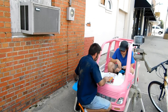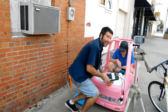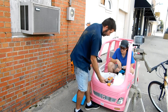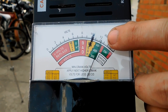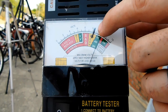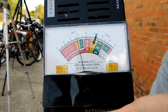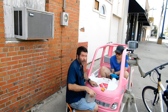So what we're gonna do is check the battery. We're gonna pop this blue hood, unplug it, and test it. I got one of these motorcycle load testers — what this does is it checks the amperage on the battery. We're going to plug this in. As you can see, it's got just over 12 volts, but when I push this button to put it under load, it should drop to the black line. If it drops below, the battery is no good. And yeah, that's bad — see how it just keeps dropping down? That's a bad battery.